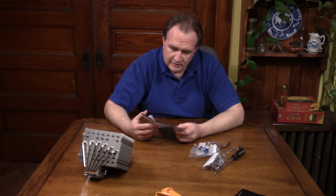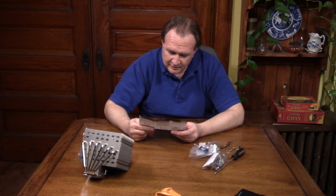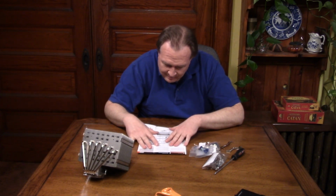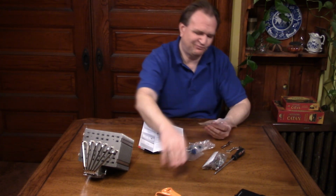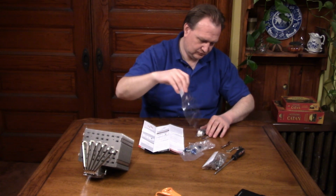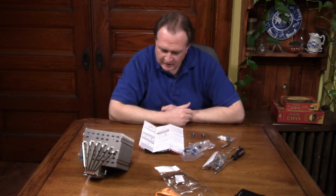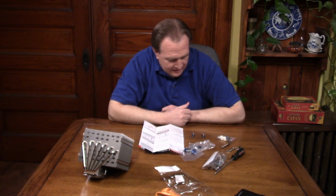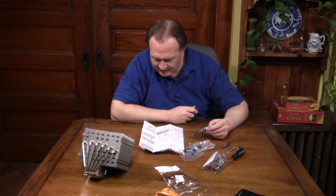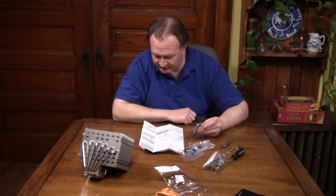Alright. Not suitable for overclocking or CPUs that create high workloads. Required mounting parts: the AMD stock backplate, which was included with the motherboard, 2 NM-AMB8s. That's these guys here. 4 times NM-ALSI, which look like they're in this bag here, 4 times NM-APS4 gray plastic spacers, and 4 times white plastic spacers.